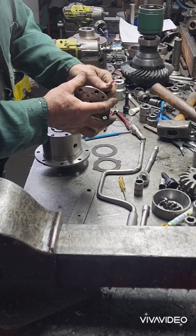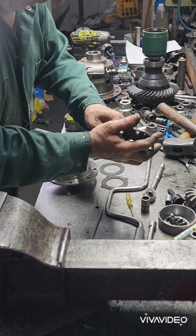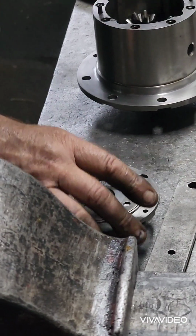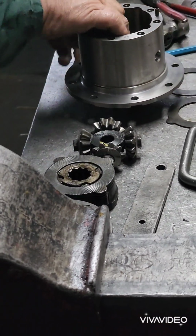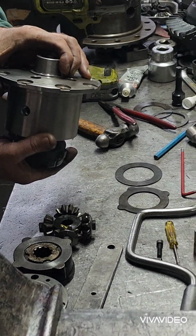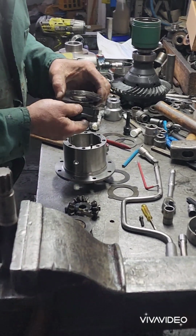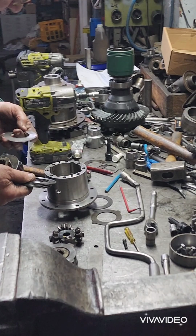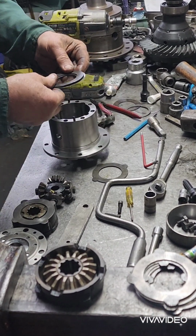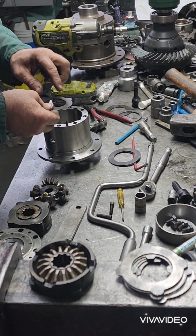Now I'll just take that 5-thou washer out of there, because if you don't do it this way, you're never quite sure what's right or wrong. So there's the washer there. That's the 5. You can put it anywhere, this shim, between the clutches, doesn't matter. On the final assembly, you put it down in there, underneath the washer, so it doesn't get worn. And in this case, that one has to go there. You put it either way, it doesn't really matter, spring-loaded.